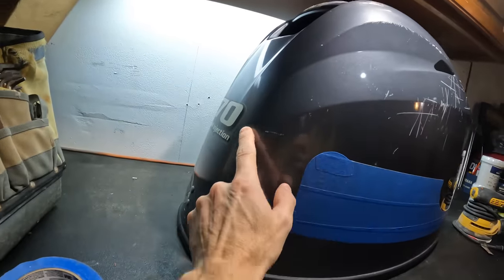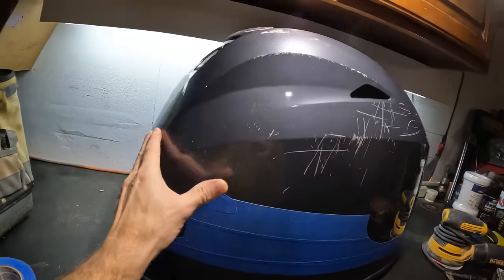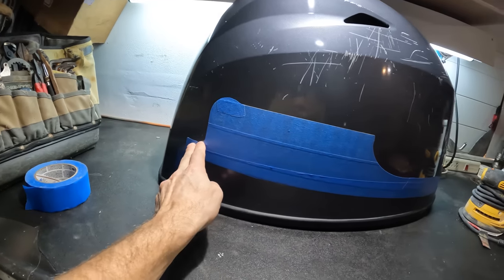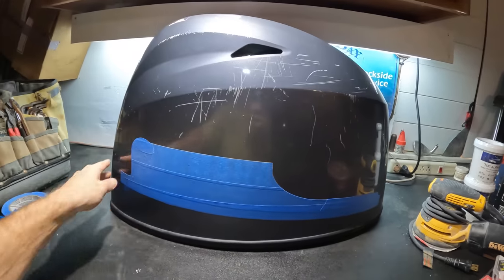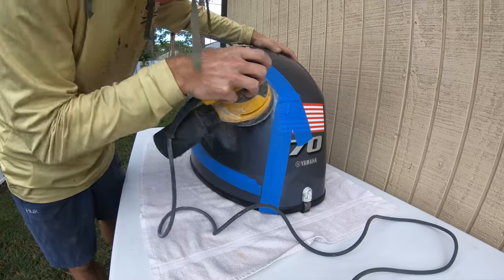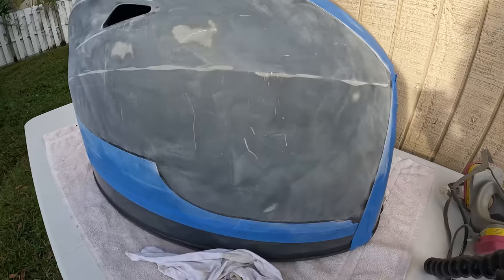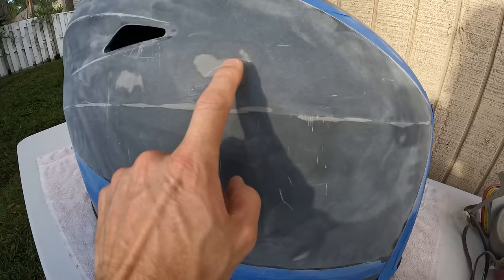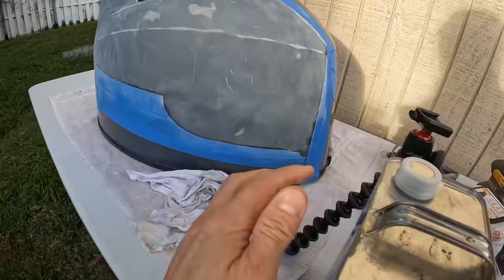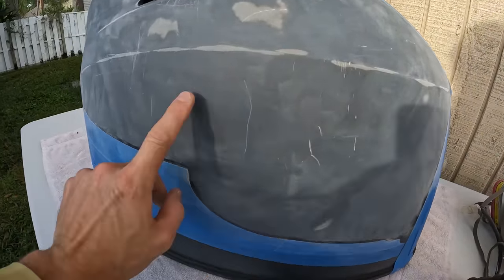Put a piece of tape along this line here at the edge, then move over to here for fading purposes with the paint. I'll probably do this circle along that edge and over to here, so I just sand this section and then we'll paint that. This has all been hit with the 320, so now we can mix up our fairing compound. We'll clean it first with some acetone — just take a rag and wipe it all down — and then once it's clean we'll fair it out with the TotalFair.